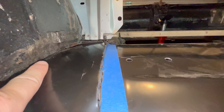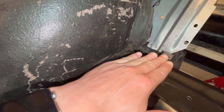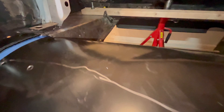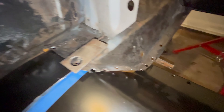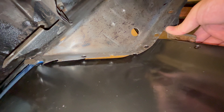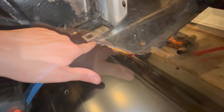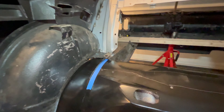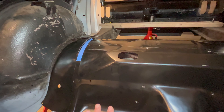From the relief cut I made, there's overlap, and a lot of this outer gap will close up once I can scoot the panel back and let it come up against the wheelhouse. At the back where the trunk sits, we've got a good inch gap back there, but once I slide this back it should close up a little better. I'll keep trying to make this fit, clean up in here on both sides, straighten out these flanges — I really didn't do a good job cleaning up the landing spots — and straighten up the wheel housing a little bit.